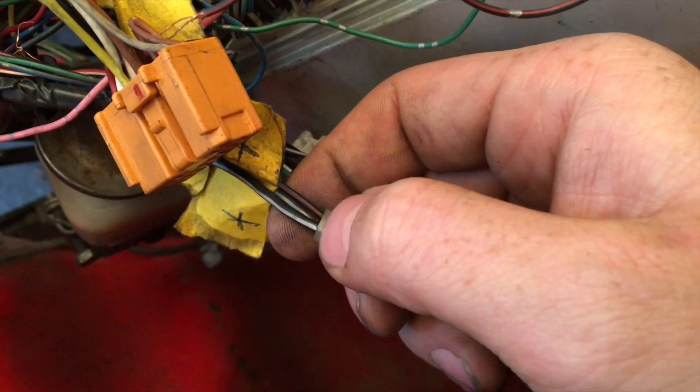You have power to the coils and injectors. This is just temporary — I'm planning to tuck the wire harness. Down here is the starter. There's going to be one post that needs a really heavy duty gauge wire. I have it running with an old pair of jumper cables tied directly to the battery. That one's for the starter.